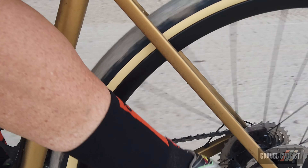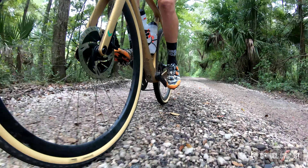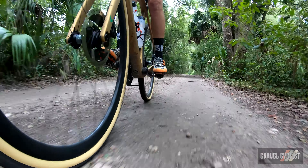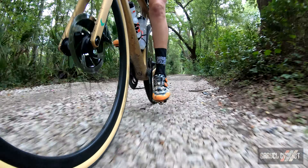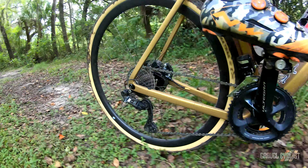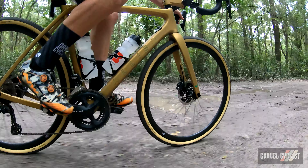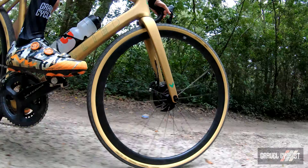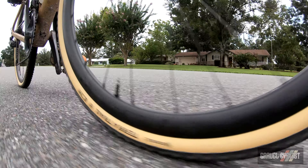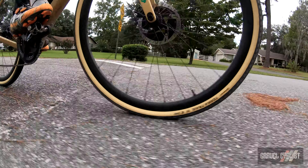Roval engineered this rim to accept tyres from 28mm up to 47mm wide, but I don't see why you couldn't go crazy and slap some 50s on it. To allow this versatility, Roval has stuck with hooked rims, which especially play well with 28mm tyres at higher pressures if so inclined. At 32mm deep, the rim is shallow enough that it won't blow about the place in crosswind conditions, but with some placebo aero action due to the rim profile you may get some benefits. Just remember, these wide tyres often act like a sail, which can be good and bad. 24 spokes front and rear is becoming a standard spoke count for disc brake wheels of this nature, and my 160-pound-ish weight couldn't budge them laterally. It's good to see Roval thinking of larger, powerful riders with a weight limit of 275 pounds or 125 kilos.